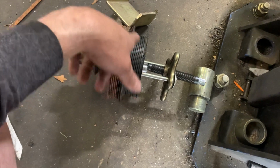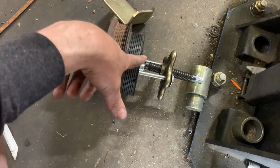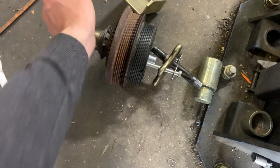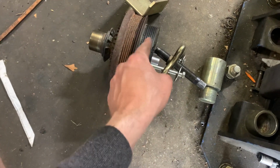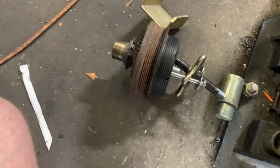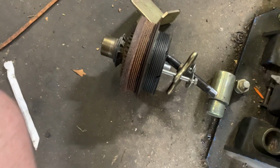And this is what actually happened. This balancer came apart. This part that goes inside the engine on the crankshaft. And so the pulley walked backwards, threw the belt down here. It kept running until it chewed through the sensor, and then bam, the car died going down the road. And that was all she wrote.